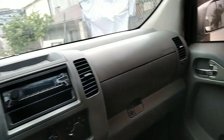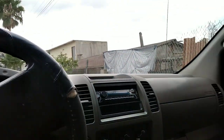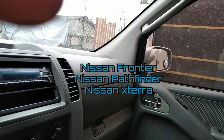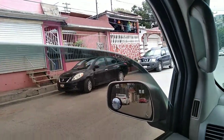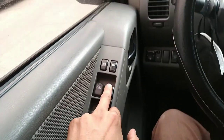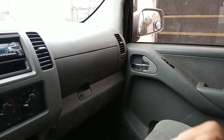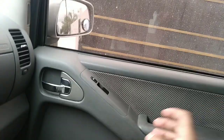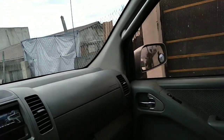What's up YouTube, today we're gonna be showing you guys how to diagnose a problem with the window on the Nissan Frontier. This process you can use to check the Nissan Frontier and Nissan Pathfinder. Right now we have this window — that one is working okay — but if I try to put down the passenger side it doesn't move. The customer states that every time he hits it, it goes up and down, but if I try from the passenger side switch it doesn't do anything.